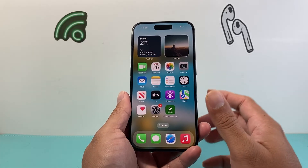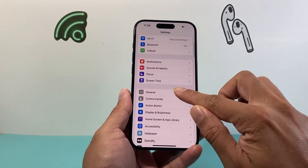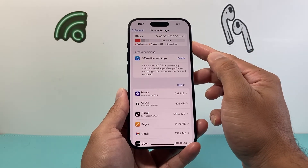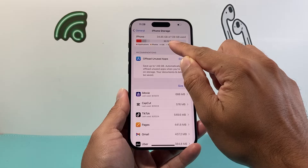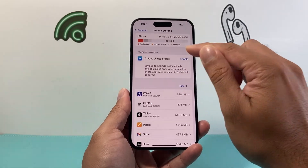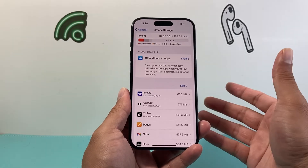After you've done that and you're still not seeing it, the next thing you want to do is go into your Settings on your iPhone, go to General, click on iPhone Storage, and check that you have at least 10 gigs or more storage available. If you see it's under 10 gigs, you want to delete some messages, some long-form videos, apps — until you have at least 10 gigs so you have enough storage to actually check for the update.